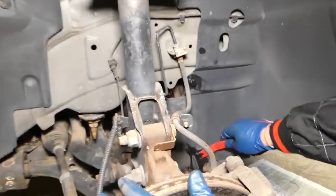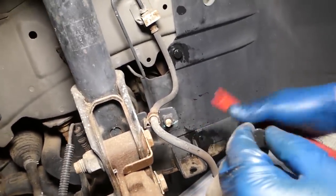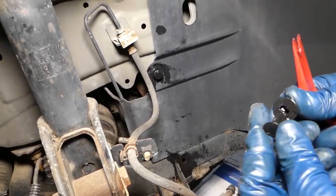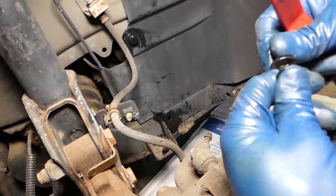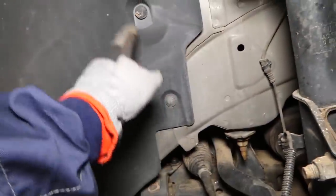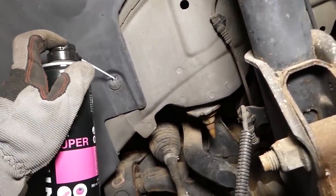Now the clips, guys, those clips, if they get stuck, check out how easy those things come out. We use special lubricating penetrating spray. So we'll show you what it is on the next clips. You need to pull the centerpiece out and then pull the whole clip as well. Now, I'm talking about these clips right here. If you try to pull them out, usually they will break.